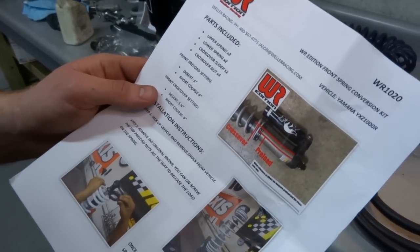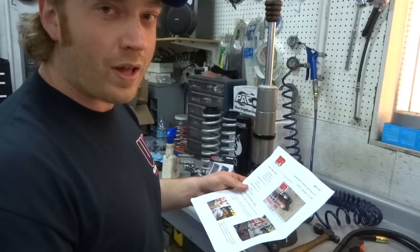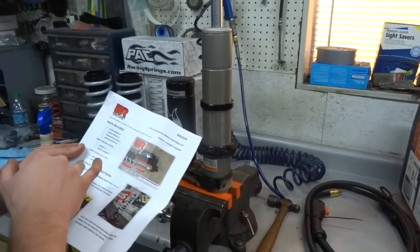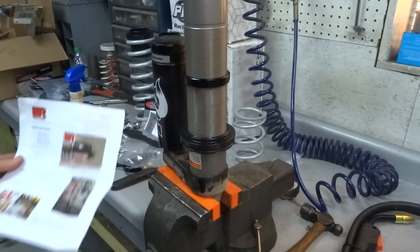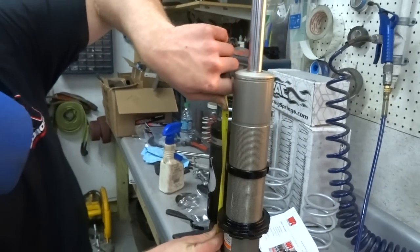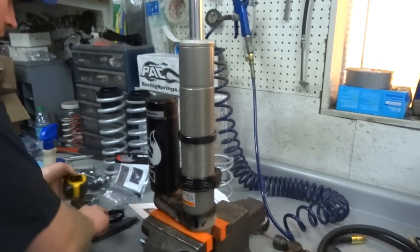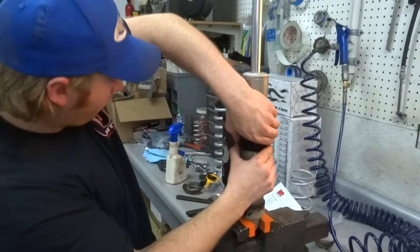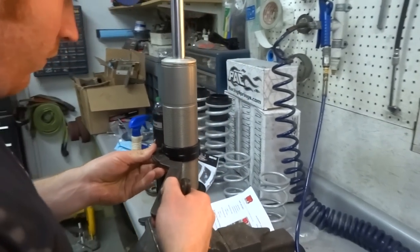We went with the desert kit as opposed to the short course kit. The short course kit is going to be lower ride height, short course type riding. Desert kit is going to be a little higher ride height, more focused on ride quality. Front preload setting desert is 5 inches from this surface to the preload nuts. What we do need to worry about is the front crossover setting - 5 and a quarter inches from this surface to the bottom of the crossover. We're at about 6 - we got a little ways to go. That's actually really close right there. So now we're going to run our second one down. This is pretty complicated - you guys might want to pay close attention. Just a lot of finger spinning.